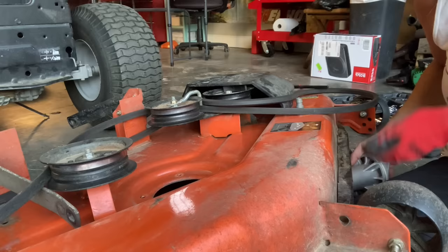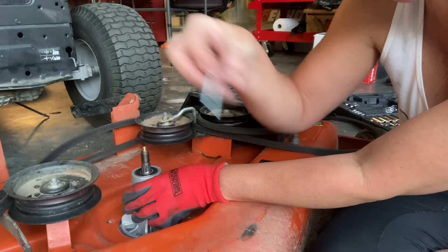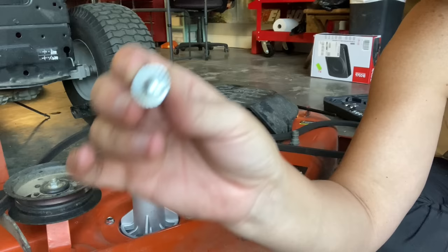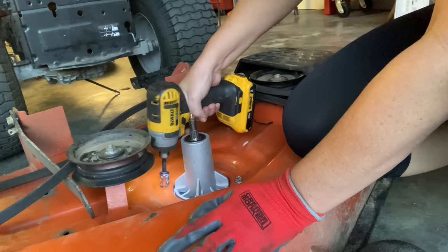This is super simple when they're tapped — you're going to put it underneath the deck, bring it up through your hole, set the deck back down, and you're going to line up your bolt holes. Start all of them by hand until you've got them as hand-tight as possible. These are locking bolts — see all those ribs around the top there? These are made to lock tight and not back out. And we're going to go ahead and tighten these down just a bit.